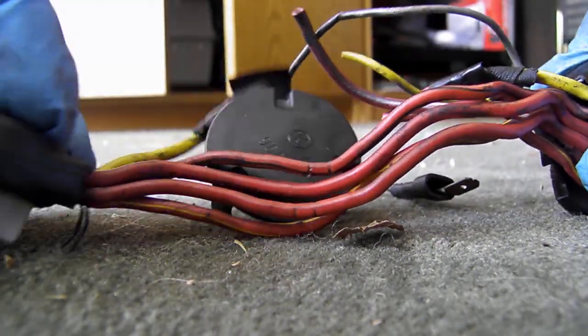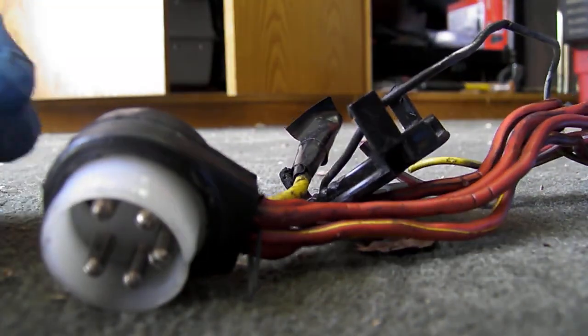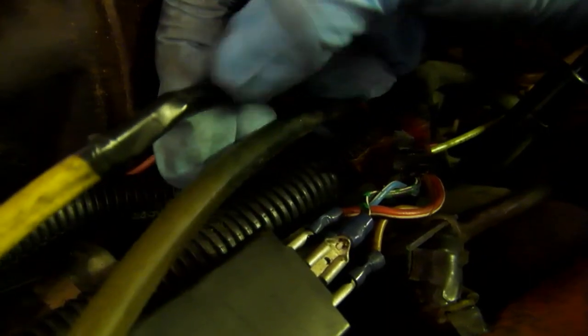The yellow wire goes through and I'll show you in the luggage compartment. Yours may be different than mine because mine's been modified a lot, but essentially it's going to come up through this little tunnel — probably in a wiring harness if your car is stock. Mine actually runs through here. I noticed somebody had originally spliced and taped the solenoid wire, so I removed the tape, inspected the solder joint, found a lot of corrosion, cleaned that up and taped it again. In my case, mine runs all the way down through this yellow solenoid wire into the back of this fuel pump relay.